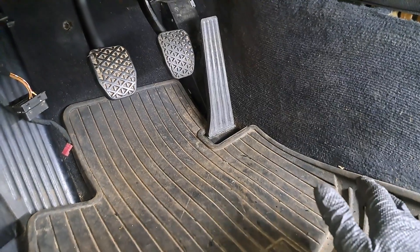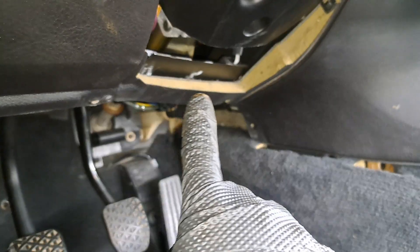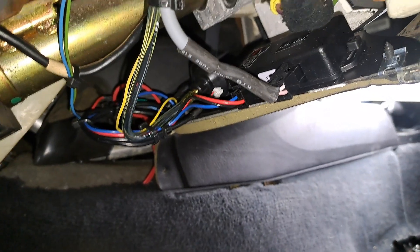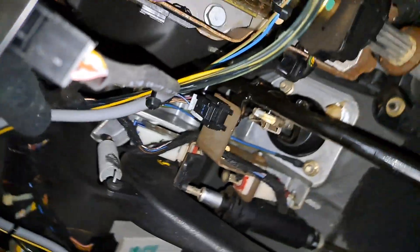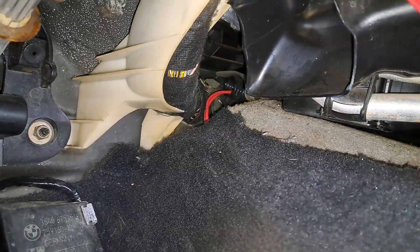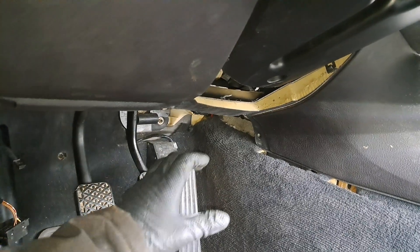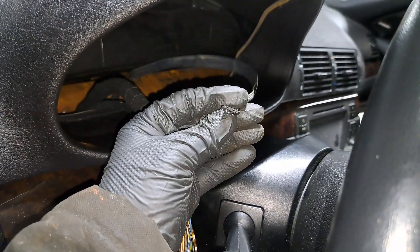Everything is installed and all the wiring is run as if it disappeared — it's all hidden up in here. I mounted the components right underneath the steering column to the bottom of the dashboard. Let's go on a small adventure underneath the dashboard so you can see where this stuff ends up. You can see the boost and AFR references attaching to the main body harness, snaking around. The chassis grounds run up and avoid the pedals, coming over up into the main area. The main power wires are tucked under the carpet, go to the tunnel, and exit up into there. There's still a big panel that covers all of this down here, so it's going to look flawless. Up here is the plug for the Zodatec gauge — it goes right to the cluster.